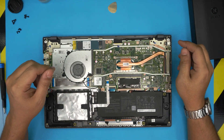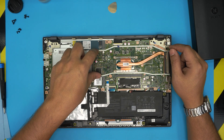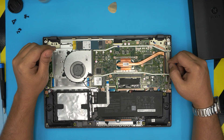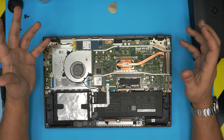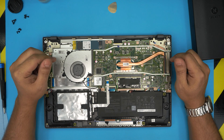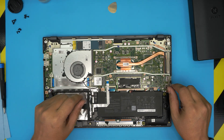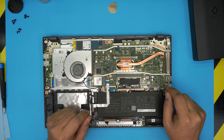Down here you're going to see a pretty horrible cooling system design. The fan is right here — it sucks air from here and blows it over the motherboard and out the back through a tiny heatsink. To put it in perspective, it's like having case fans on a PC but no fan directly on the CPU cooler — there should be a fan right over the heatsink directly.